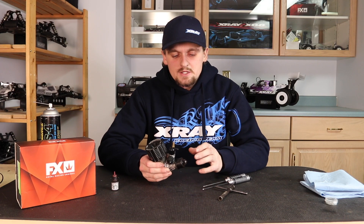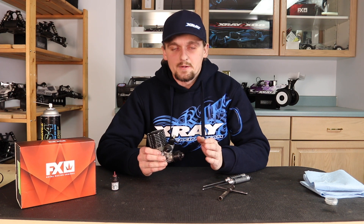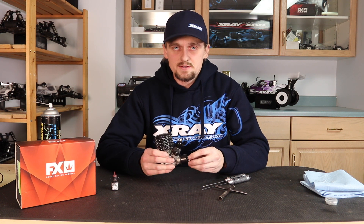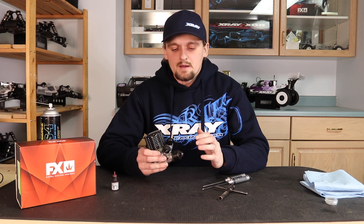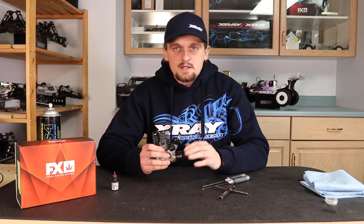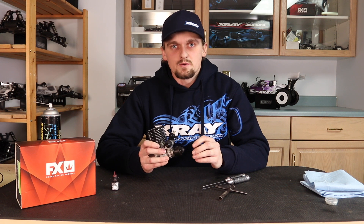That's how I assemble my clutch. The clutch is very important — if it's not set up properly or not maintained properly it can really affect your tune. If your car is running on in the air and the clutch is hanging up, it's not letting itself disengage and it'll make you think your engine's too lean when it's really the clutch. Or if your engine is bogging on the bottom end it could be engaging too soon, giving you a false sense that your engine is too lean on the bottom. Even if your engine dies out at really low idle it could be your clutch hanging up and not letting the motor idle properly. So there are a lot of things that can seem like a tune issue but are really clutch setup or maintenance. That's it for the clutch video — stay tuned for the next video on the fuel system, and hopefully you guys enjoyed it. Thanks for watching.